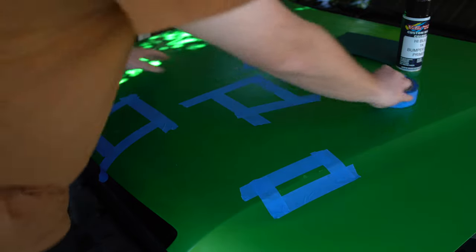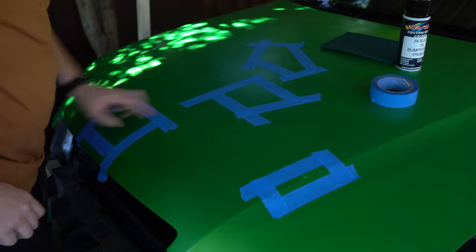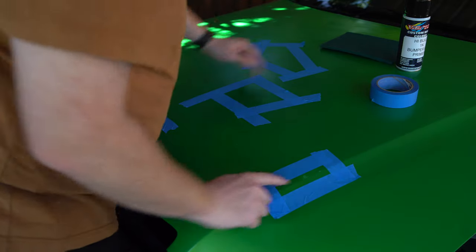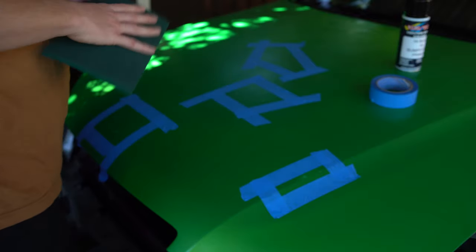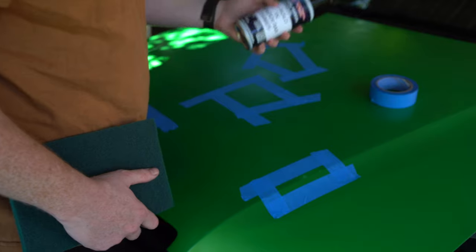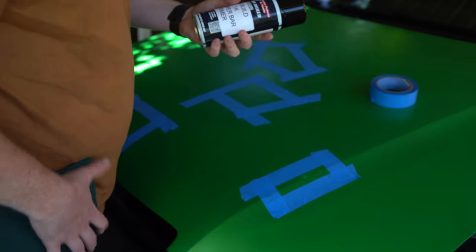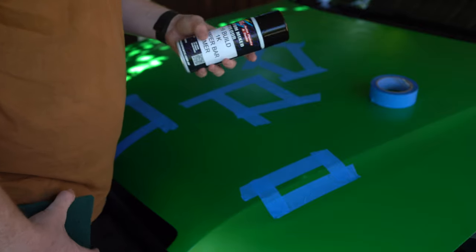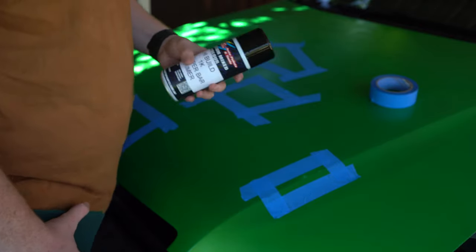There are the affected portions - it's pretty bad there and there's a couple of little spots. Just giving it a bit of a scuff up. I've got a high build 1K primer - I can spray that on and sand it down how I need to, and as long as it's flat, you won't even be able to see it under the wrap.